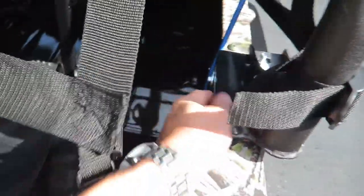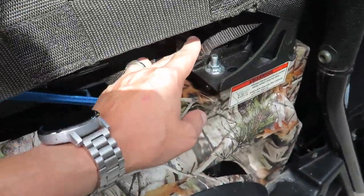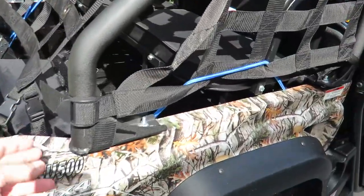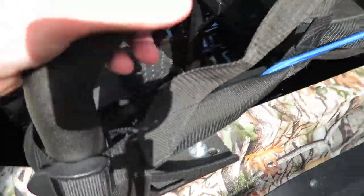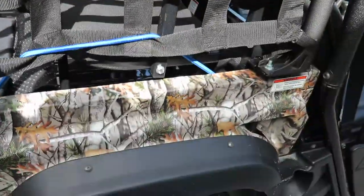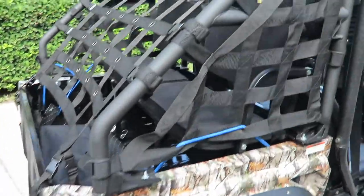So I had to buy these heavy duty L brackets that are here, and they have a couple holes in them. I bolted it securely to the bed here and then to the bed here as well. So I've got four L brackets all the way around on each corner, and that allows the roll bar to extend out a bit from the bed, and then I can attach it. But it's solid. When I'm pulling this, shaking it, it's wiggling the whole vehicle. So very solid construction there. I think it makes the back a little bit more solid as well.